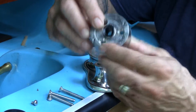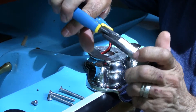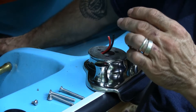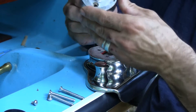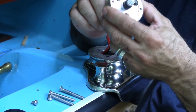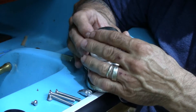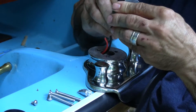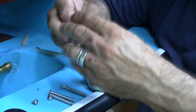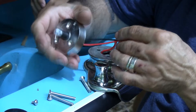This is one of the original fittings that was in there — I started to take it out to measure the hole but it's in there pretty good, almost press-fitted. This should fit right in there — it's a half-inch. The socket for this bulb is also a half-inch OD, which gives me the capability to change bulbs in the future. It's got a ridge — it's almost like it was made for this. The bulb should pop in and out, and it'll sit in there with the wires sorted together.